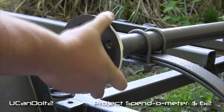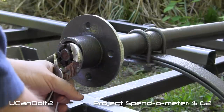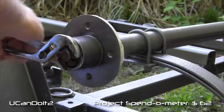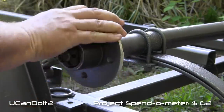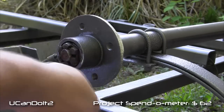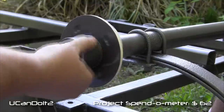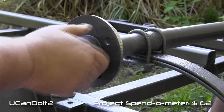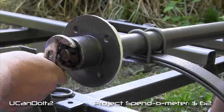That's as far as that nut will go. It's a little tight there, so I'm going to back off and see how that goes. Let's go this way with it. It's not going to just spin freely because it's got all that fresh grease in there that's basically causing a lot of friction. But it doesn't have any play in and out, which the old version did with the rusted bearings. But that's going to be just perfect there. I'm going to loosen up just a little more right there.